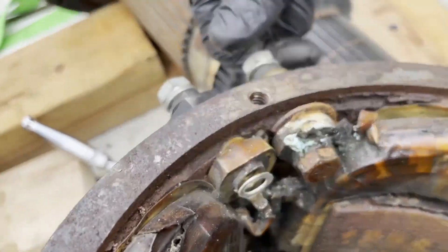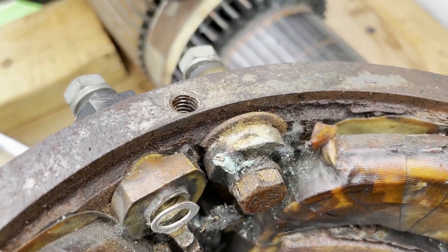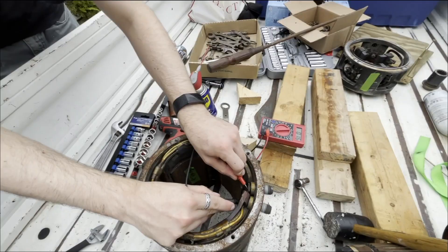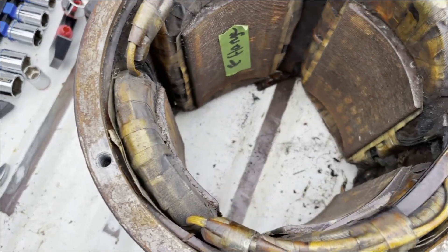We're hoping the warranty hasn't expired. There was an insane amount of corrosion on this wire, and when we were taking it out, it just snapped — I'm not going to blame us, because it looks like it was definitely ready to go. With a piece having come out of our motor, it seemed important to test continuity to make sure nothing else had been broken.